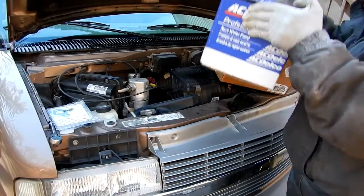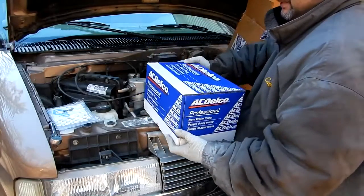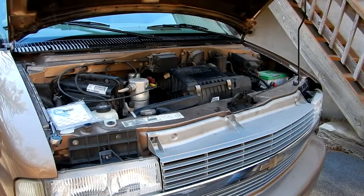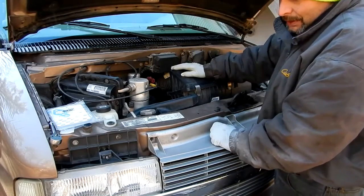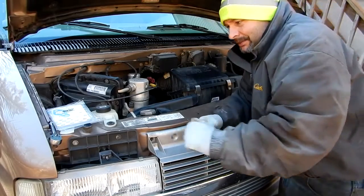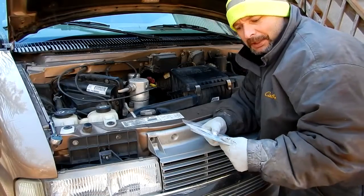Here's my new pump — I haven't even opened it yet because it's still sealed. It's for the Chevy Astro. I'm going to take it all apart and see how the pump is. I'll take the belt off, wiggle it, and if the bearing is still good then it's just the seal slowly going bad. I'll leave it alone — you can drive 10, 20, 30 thousand miles on a slow pump leak. But if I get any play in the bearing, then I'll swap it out.